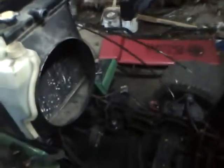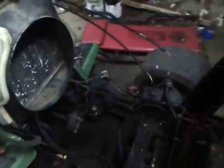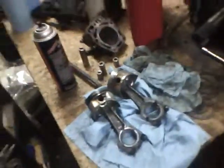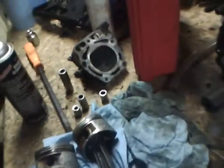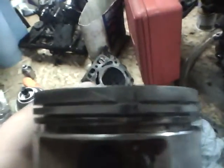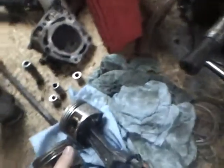We also had some problems with the governor — we got the governor fixed and put it back on the Deere. We found the problem: she did not have power. She's a twin cylinder engine, but there was just something wrong because she had no power and she just kept blowing oil and smoke. We couldn't figure out why, so a friend of ours — who actually sold us this mower — came over and we took the pistons out because we figured it was the pistons that went bad. Looking at it, this one actually was clean, but this one — if you look right where my thumb is — you can see a piece of metal in there. It looks like one of the rings is still in there.